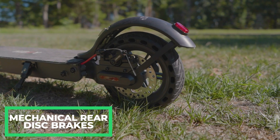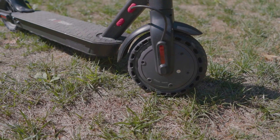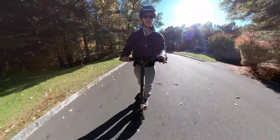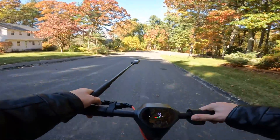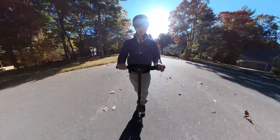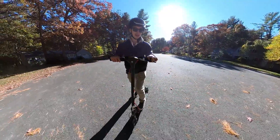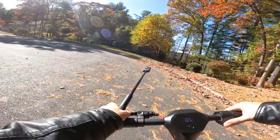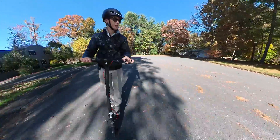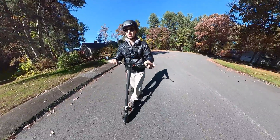Let's talk about the brakes. This has mechanical disc brakes in the back that blend with regen brakes from the motor. The regen brakes are actually pretty strong. One thing the scooter does — which is a safety measure but I'm not super fond of — is that when you're going downhill, even if you're coasting, the motor kicks in with regen brakes to keep you from exceeding 20 miles an hour. At 20 miles an hour with full brakes, it's actually less effective to go full brakes because I locked up the back tire and it was sliding. But the regen brakes contribute a great deal to slowing down, so you don't really have to use the actual disc brakes a whole lot.